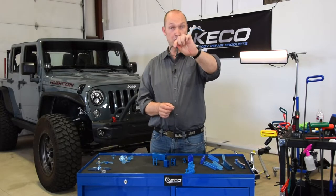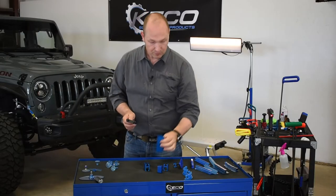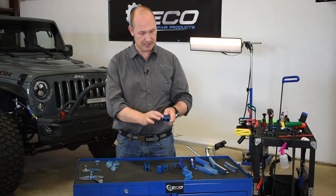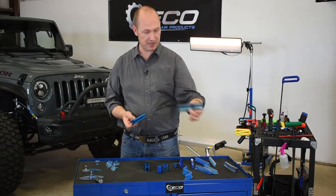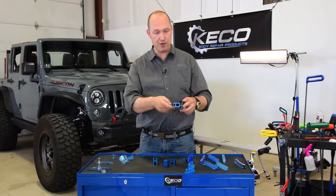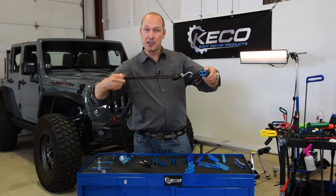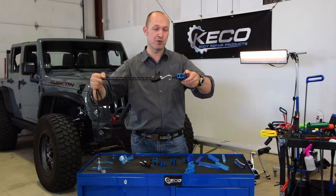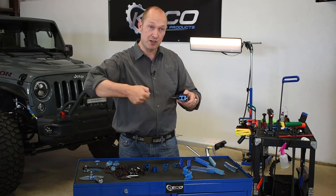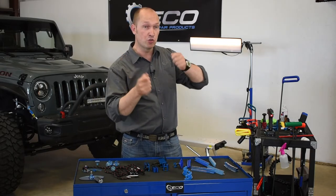The extra one — something very special — a U-bolt. Why would we use this feature, a U-bolt? Same adapter: you slide the U-bolt in there and fix it. It grabs onto these big centipedes or other ones you're using to repair that big dent you're working on. You slide it over and you can use some straps that you hook on there, pull them, put tension on the dent, and it gives you two free hands to work. Or even better, if you have a hydraulic rack system, use your chain — put tension on it, pull that rocker, pull that door — leave tension on it and you've got both hands free while the hook is on it to work around it and pull that big dent out.